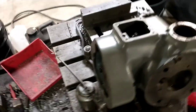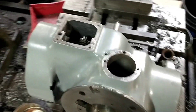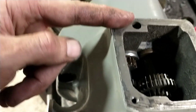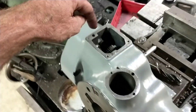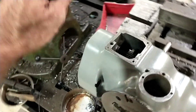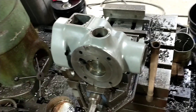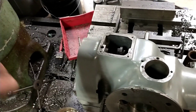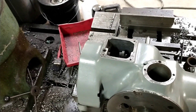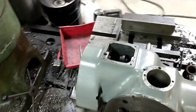For those of you that have or haven't seen one, this is the quill feed swinging casting here. It is held in — you can see it turning — it's got a groove cut in it. In this hole there's what I believe they call a dog nose set screw that runs in and just slips into that groove, and that's all that keeps it from coming out. Behind it they run in a jam set screw — like just the very top of a set screw where the hex goes all the way through, super thin. This one has had one of those classic gorilla man tightened-it-up moves where somebody reefed on it and cracked it. Once you crack those stupid things, especially when they're tight, they're virtually impossible to get out because they wedge themselves in place and act like an internal collet, and then the Allen wrench just slips in them.